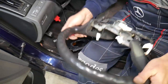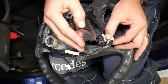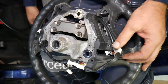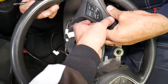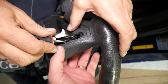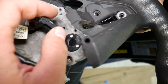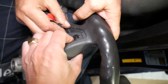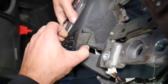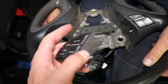Now if you need to remove the cruise control or any steering wheel switch, all you have to do is unscrew it from behind. You can see a couple of screws — one there as well. This one should be for the cruise control. You may need to disconnect it. It's a little stuck — probably had some spilled stuff. Just grab it and it comes out. That's the cruise control switch removed.